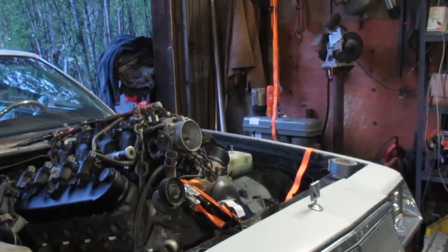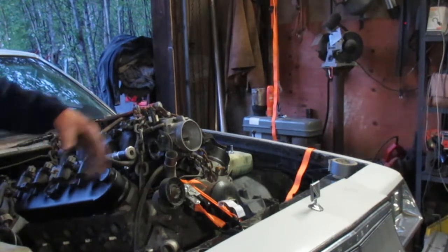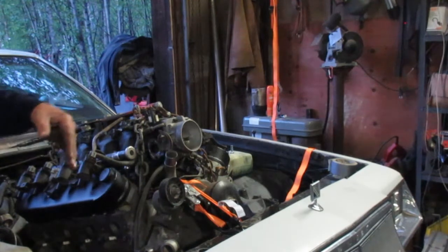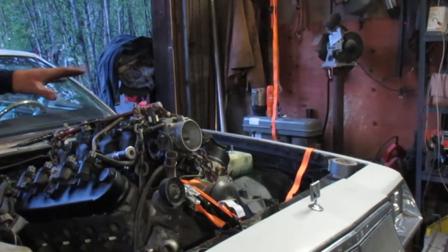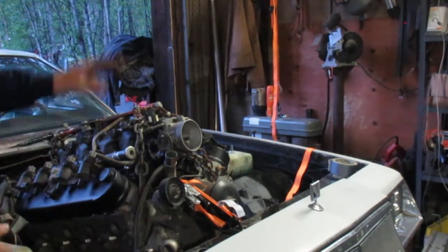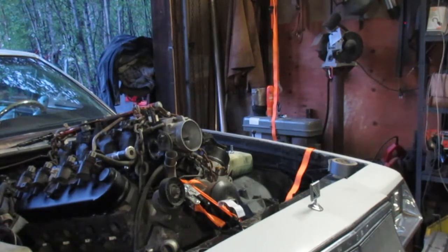I think I'll obviously proceed with the install. We're short maybe 100 and some odd pounds worth of front end gear, radiator, the hood, maybe the battery. We'll get it sitting in here the way it should with all the other accessories and extra weight on there before I decide on whether I need to buy myself a different set of springs. Just remains to be seen.